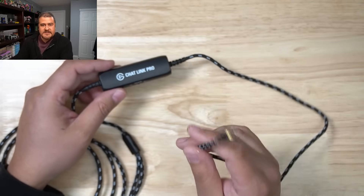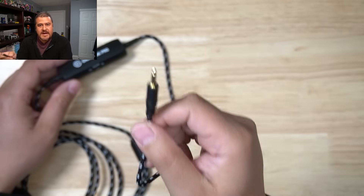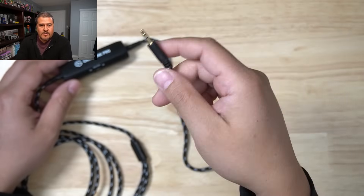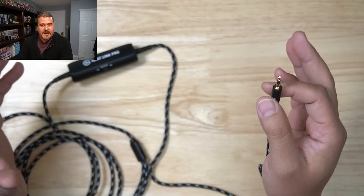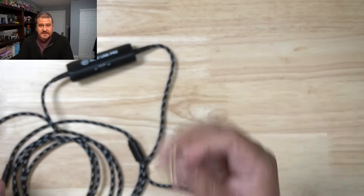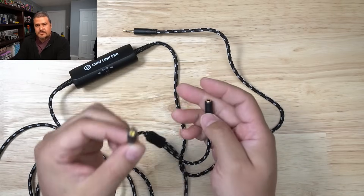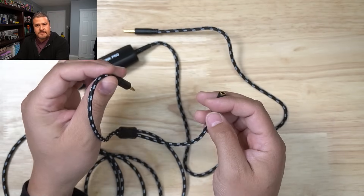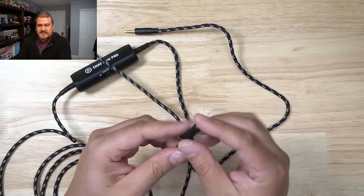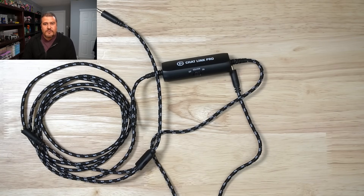How this is going to work is basically this cable is going to go to the line-in on my actual computer. I might do another video on how to set up a PlayStation 5 or even the Switch and how you could connect the audio and actually capture the audio and video on it. But nonetheless, this goes in the line-in port of your computer, and then this side will go to the actual Switch itself. The Switch has a 3.5 millimeter port — you just go right ahead and connect that there. And then on this end, you'll have your actual headphones connected.